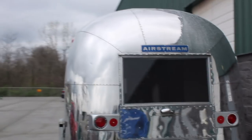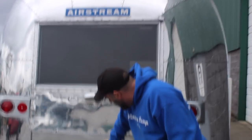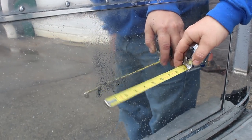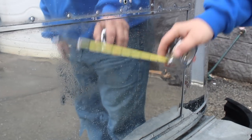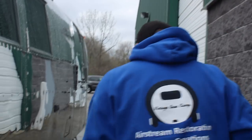You can see it in the profile. There are some issues back here — the bridge has a little bit of something metal on the back side. There's a little pitting about 5x5 on this back hatch. There could have been a sticker back there at one time that caused the pitting. On the back road side, the rub rail has pulled up just a little bit — hammer and dolly can get that down.